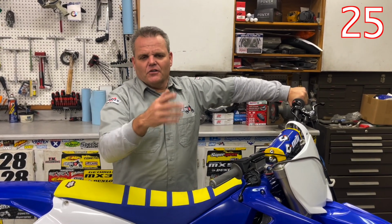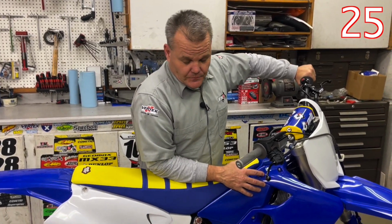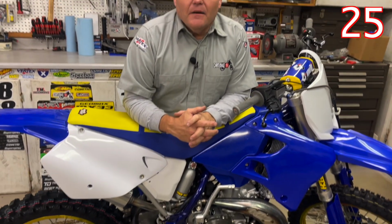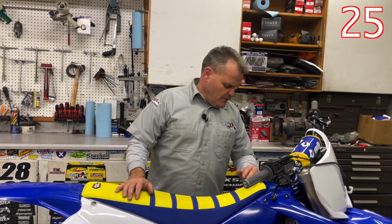And there's good guys out there that are real good with two strokes. Varner's still around. Tom Morgan does a lot of our work back in Minnesota. He does a really good job. So two strokes, those modifications are pretty simple. Pipe, silencer, head cut, porting. Not too expensive compared to four strokes to do some of that stuff.